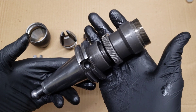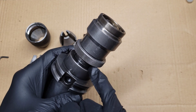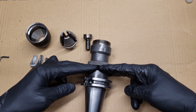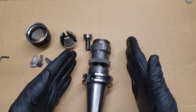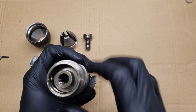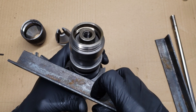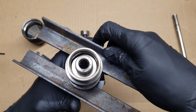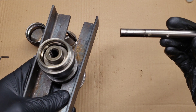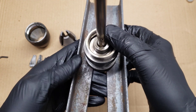At this point it was very difficult to continue the disassembly because this was not spinning and the chuck was not coming off of the taper. Now there are wedges that you can place in from both sides that you can press in a vise or hammer to try to wedge the chuck off the taper. This chuck has a through hole so you can see the end of the taper down there, so I was able to support this on top of some blocks and use a shaft or punch through here to push the taper out.